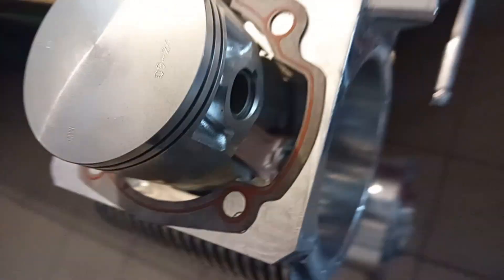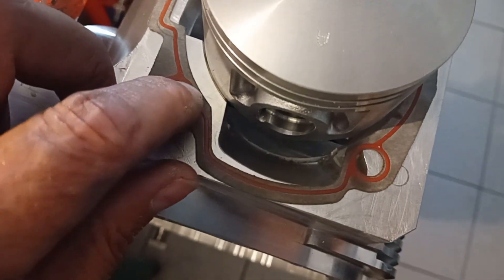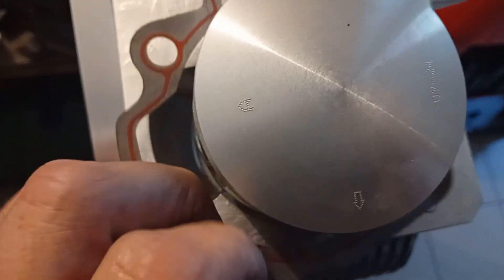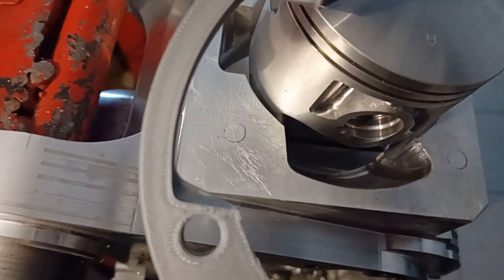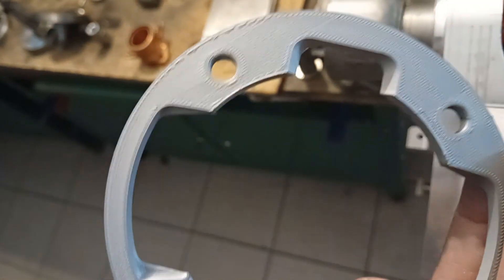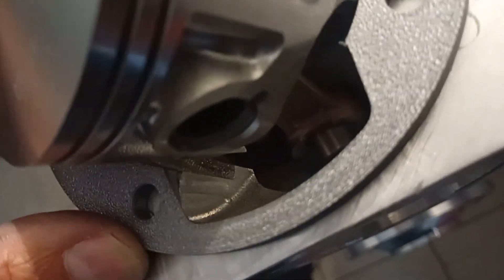Before showing the 125mm conrod situation, here with the gasket you can see the faces are very different. It's not much, but it leads to a situation where there is almost no sealing face. To avoid that, and because we need to put in a packing piece anyway, I have designed a spacer where this side comes down, covering the larger boost ports and guiding them to the barrel opening. This side is a little larger and transitions into the form of the barrel opening.